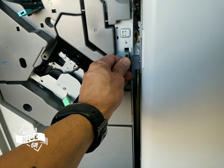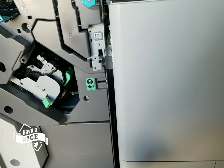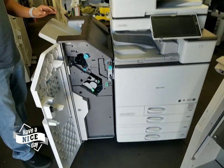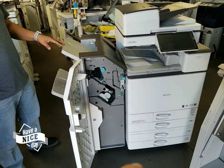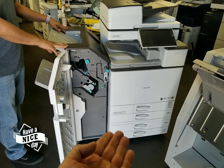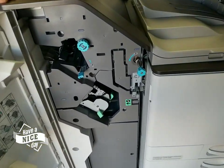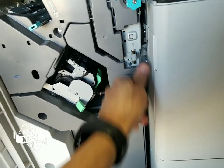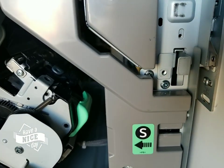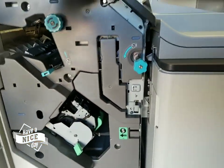If for whatever reason this bracket does not push in, your copier is sitting a little lower than the finisher. I've seen that happen many times where if the machine is installed on plush carpet, since the copier weighs a lot more than the finisher, the copier will sink down lower. You just have to find a way to prop it up a little while somebody helps you click it in. Once you get it locked, that's all you have to worry about. You can put a screw there if you like — it's really not needed — but for this to come out, it's nearly impossible.